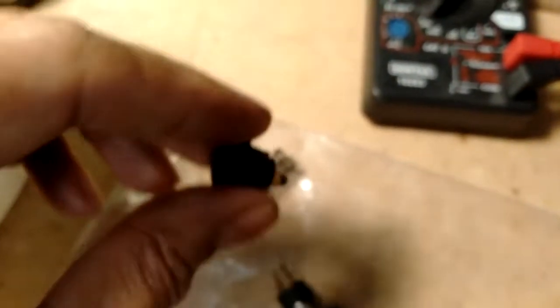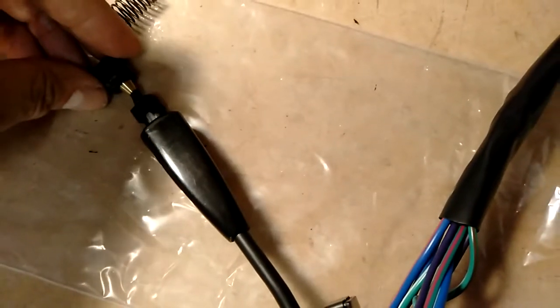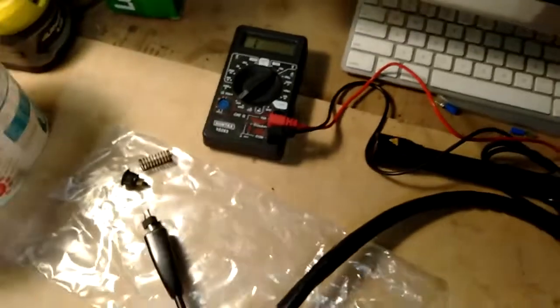And it was sort of slightly out like that, so whenever I move the assembly, the little brass piece is loose, and then you tip the whole assembly, and of course that brass would move down and touch those and cause the horn to go off when it shouldn't.